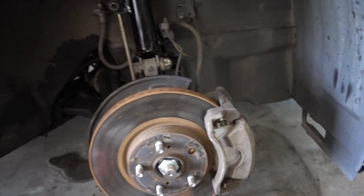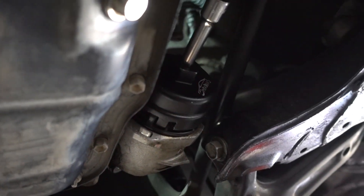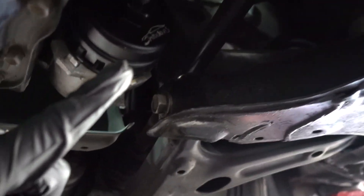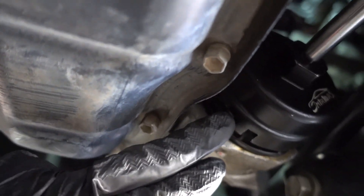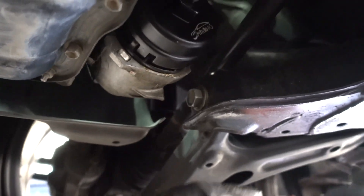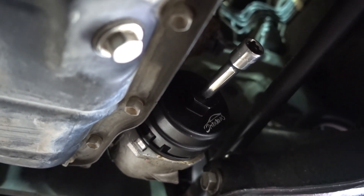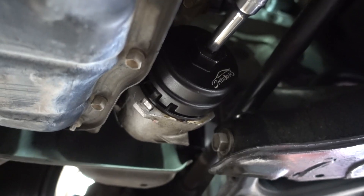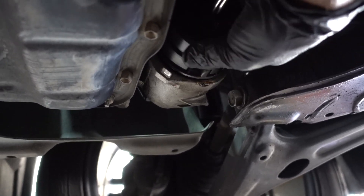Once I finish that, we're moving to the oil filter. Suspension is done. Okay guys, I get it out. I was going to use the rack and the oil filter tool to remove it, but it was slipping. I grabbed this one — I bought it online because it has the little cutout for the little ears on the housing. I used my stubby. I just started hitting on it and it came loose. Really easy — I thought it was going to give me more trouble. Thankfully it came out.